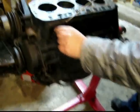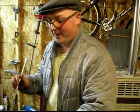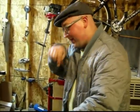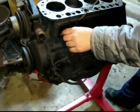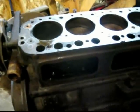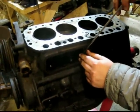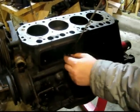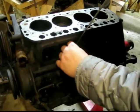So Marty, what do the tappets do? They ride on the lobes of the camshaft. Okay. So the camshaft's a big shaft with lobes on it, and that controls the timing of the intake and exhaust cycles, as well as of the valves, and how long those valves stay open. So the duration. I think usually in race cars they have what's called a high duration camshaft, so it holds those valves open longer.